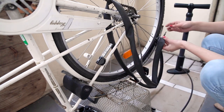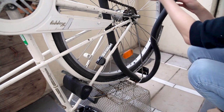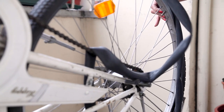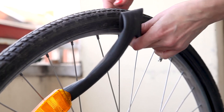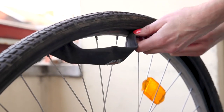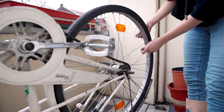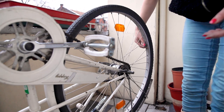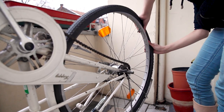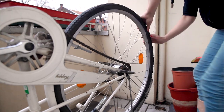It's been a couple of minutes, so I'll give it a quick pump to make sure there's no second hole and that our fix is good. Running my fingers along the sides again feeling for any air — it's looking good. Time to get the tube back inside the outer tire, starting by putting the valve shaft in first so everything is in place without too much tension. Shove the tube up into the casing of the outer tire — it's a bit easier. Make sure you don't have any twists in the tube, and mind the chain. Reassemble the valve completely, but don't fully tighten the rim nut just yet. Pop the tire back into the rim starting at the valve, continuing left and right. Use your hands rather than levers where possible, as levers can damage the inside tubing.